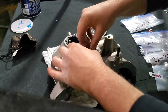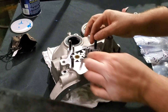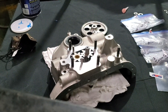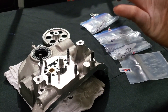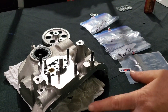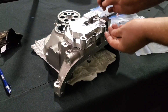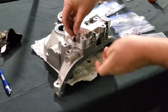We're going to put the c-clip in — it locks it all together. There we go. Blue lube the gears and bushings, acetone the front face. With blue lube on the gears and everything set up, we can actually drop the front down. Flat washers, lock washers, nuts, and we'll loctite those down.